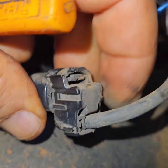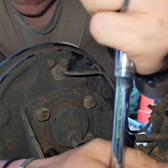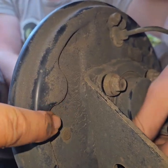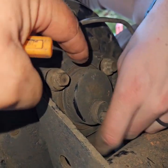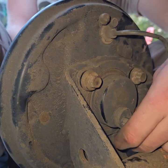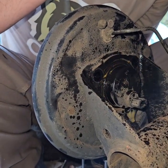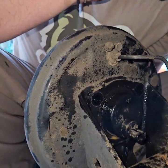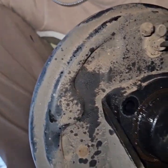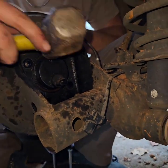Hopefully it didn't break — sometimes they break and then you got a zippy time. Now when you're doing these, this whole plate wants to come off with the bearing, and you don't want that to happen. It's really difficult if this is rusted to get this thing off of this plate — that's the backer plate for the brakes. This whole ring right here gets stuck when you pop this out. You got to be careful of the brake line — don't break the brake line. Go ahead and tap on that cover while you're pushing on the plate.